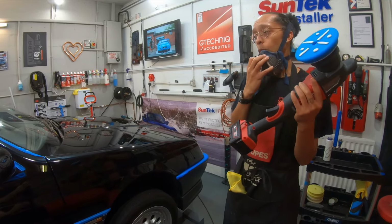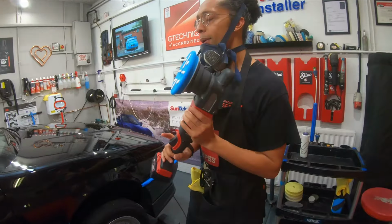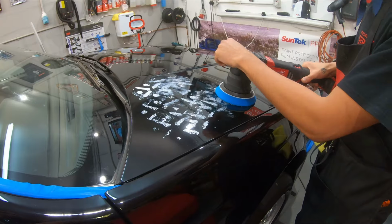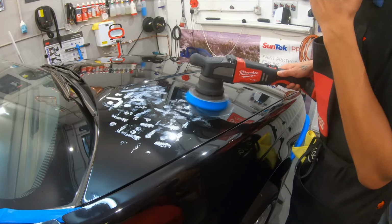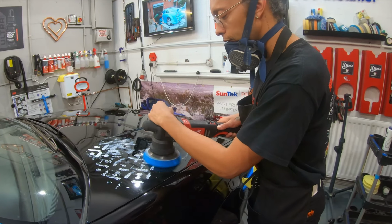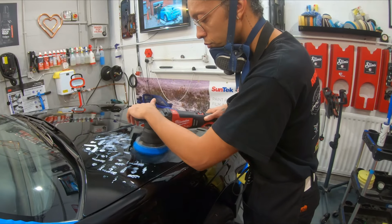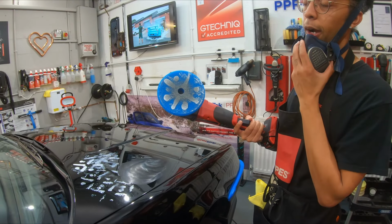While we're at this point, I'm going to show you how to prime a pad for anybody that's interested. So if you look at the pattern in there, priming a pad, what I'm going to do, go to my low speed, just do a few dots. Might get a bit of sling, but what we'll do, turn it on, move up to about, and I'm not putting too much pressure, you'll hear the machine, hear that? And just hold it in that same rough area for about 20 seconds. And that is what you want to see roughly for a primed pad.